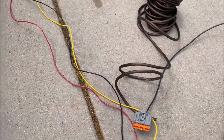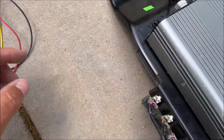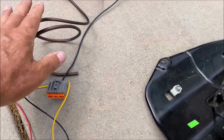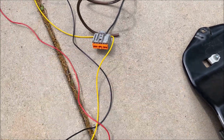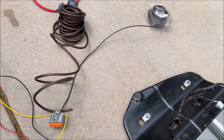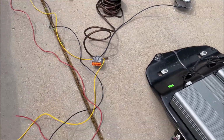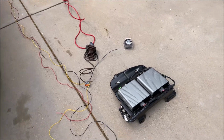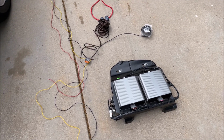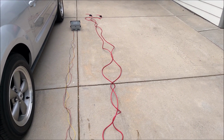When I run these wires to this plug here, I'm going to put them obviously on the right pins that match up to this. The remote turn on, the left and right channel, and then the 4 power leads into here that match the 4 over here, and then ground wire. That's not going to be the ground that I use, that's just a representation. And then the ground wires will get grounded somewhere in the trunk, and that is how it's going to be wired. So hopefully that's helpful, just to see how these Shaker 1000 amps are wired. And this is what you're going to have to do if you don't have any of the amp wiring in your car.